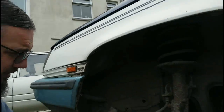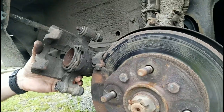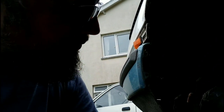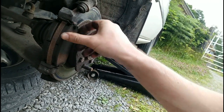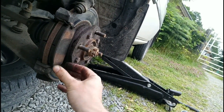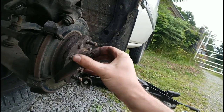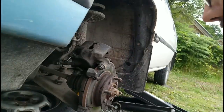I'm in and there's definitely a bit of damage around the rubber on the piston, which isn't particularly helpful. But the pads are in pretty decent nick, so I'll probably clean them up. You can see these edges aren't particularly happy sliding back and forth, so I'll just get everything off, clean it all up, and hope for the best.